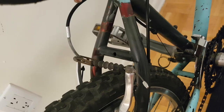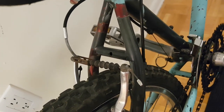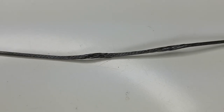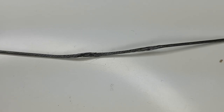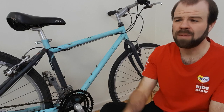However, it's a bit more tricky to do now because large sections of the cable are enclosed inside of the cable housing. You could try undoing the cable and threading it all the way back through all the pieces of cable housing, but I really don't recommend doing that. The pinching method used for fastening the ends of cables causes the cable to deform, so if you remove the cable and try to re-thread it back through, it might get caught and frayed. A much better option is to leave the cable fastened in place, but reposition the pieces of cable housing to different points along the cable so that you can apply lubricant to all parts of the cable.